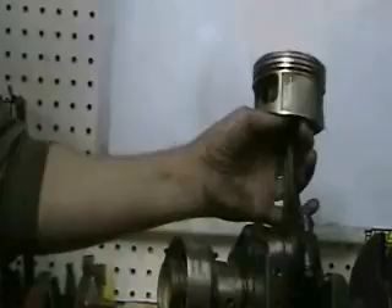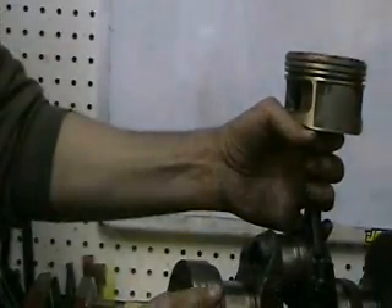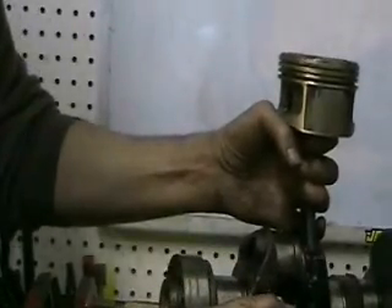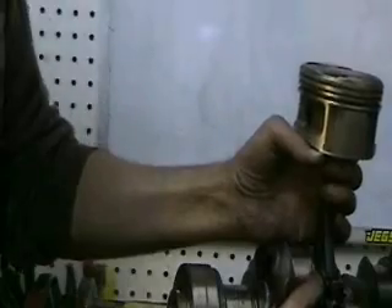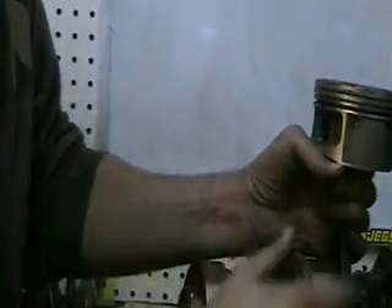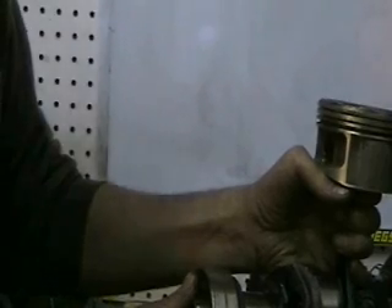So what we're doing in this test is — remember, we've got this piston and it's all loose. What we did was bring it up to top dead center. If we push on the piston at top dead center, nothing's going to happen because the piston is resting right on the journal. However, we went past top dead center, so the crankshaft engages with the bottom of the piston — the cap — and that creates a gap in the top part of the rod. As we're moving down, we've generated a gap as the crankshaft pulls on the cap to pull the piston down. We then took a screwdriver and by pushing on the piston, we closed that gap. We can feel the movement, we can hear the rod hitting the journal, basically simulating the rod knock — and that's what this test does.